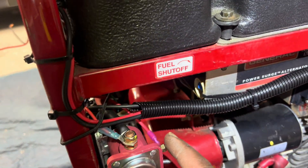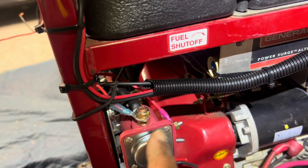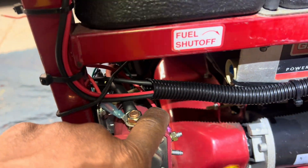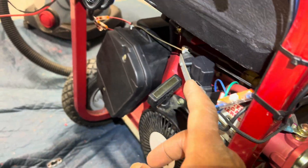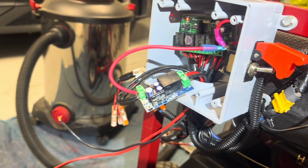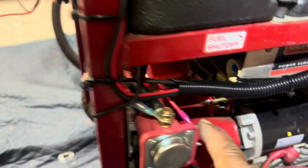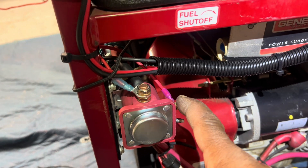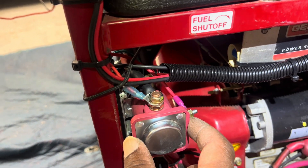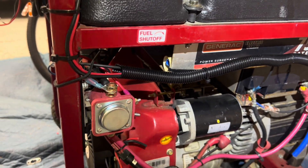You gotta put a wire in right here that energizes the relay - the solenoid. This wire right here energizes the solenoid, and that red wire runs back over into the four-way relay. When I kick in the blue button, that energizes and sends power over here to the center node, which closes the contacts. The center node will send power out to the starter, and when you release the button it starts. That's how that system works.